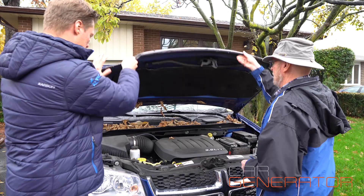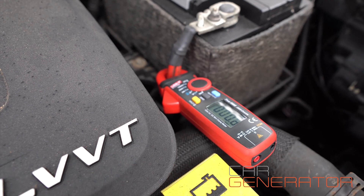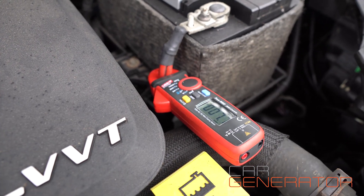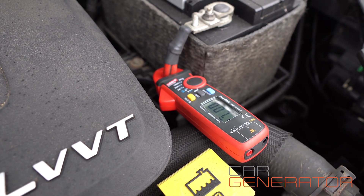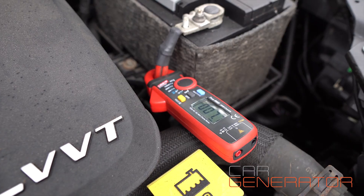So today we're going to use this handy gadget which is called a DC clamp amp meter, and we will look to see exactly how much power just using the regular things in the car uses — your headlights, your wipers, all those kinds of things, cabin fan. Let's have a look at that. You can see we're using 10 amps, so that's just on accessory mode. And if you open the door you can see when the interior lights are on, we're using 7 amps.